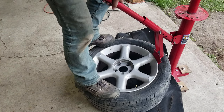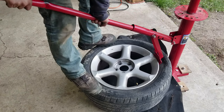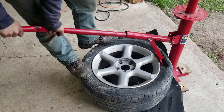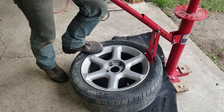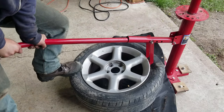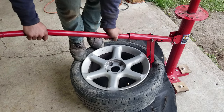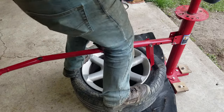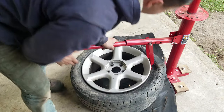You don't have to do this, but I like to stand on the tire when breaking the bead because sometimes you get the whole bead to go at once. I got the tire too close — just trying to pick it up. Maybe I can step it off. Here we go. It's hard to do in boots. Tip the whole bead off — yep, it's off the bead.